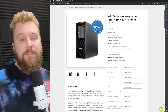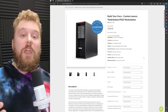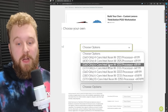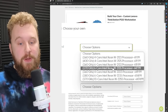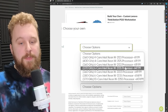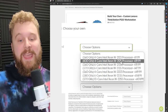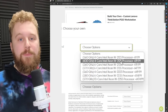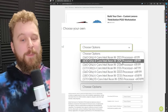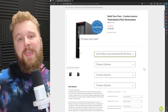We'll show you the final configuration you should buy from PC Server Parts so you can follow along with no problems. The Xeon we recommend for your P520 is one of two options — both are 6-core 12-threaded Xeons. You either want the W2133 or W2135. The 2135 gives you a slight performance uplift, but the 2133 gives you 6 cores and 12 threads at really good bang for the buck. We recommend the 2133 if you want to save money — you won't notice a major performance difference.